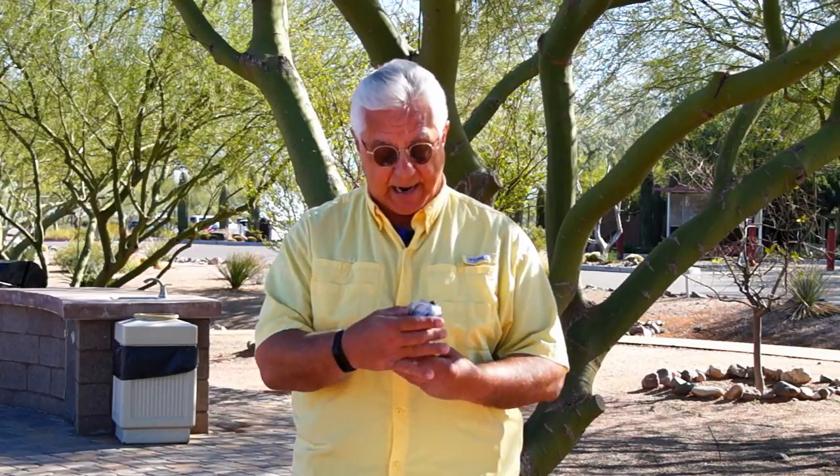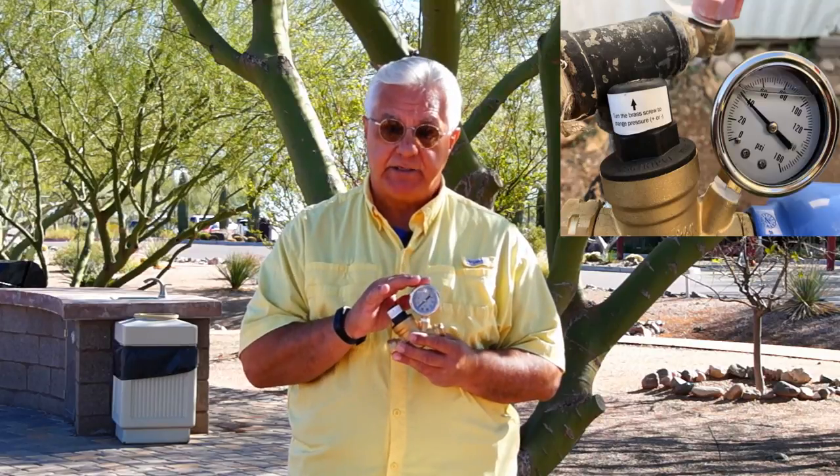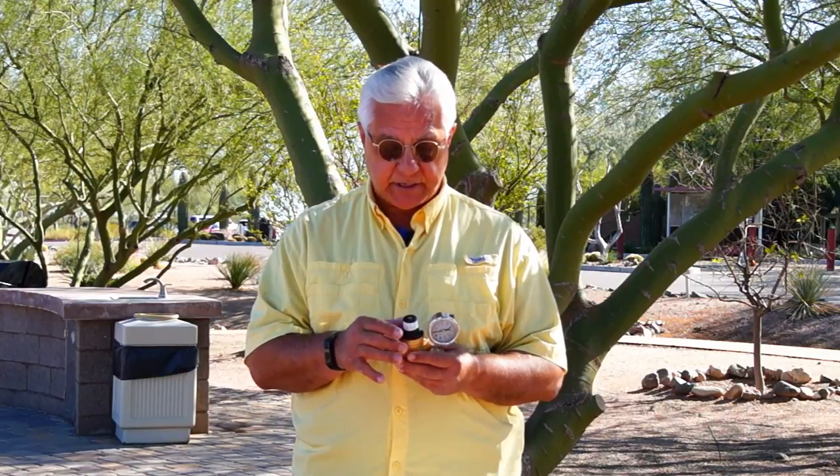Here's my third tip: when you buy a water pressure regulator, I recommend getting one that has a gauge on it — not just a dial that says good, fair, or poor, but a real gauge that tells you what the PSI is of the water actually going into your RV. These gauges can also be adjusted with a small screw on top. If you need a little more water pressure, tighten it down; if it's high to begin with, loosen it up. The whole idea is that with a gauge you know what you're working with, rather than hoping a dial is doing the right thing.